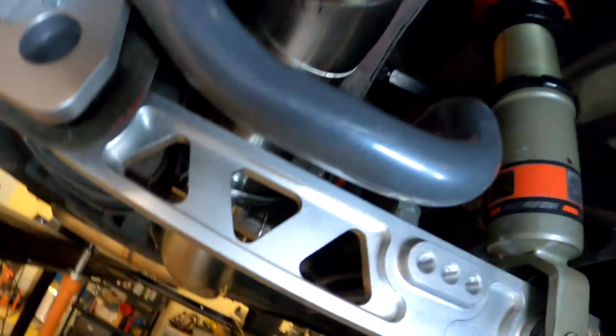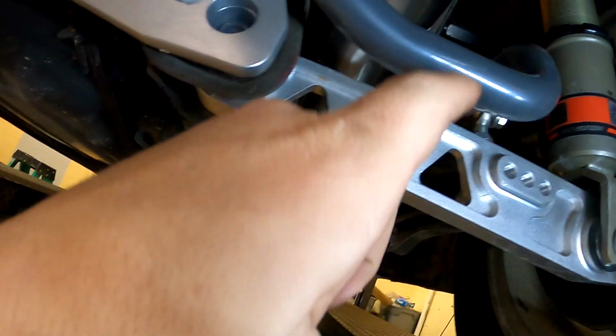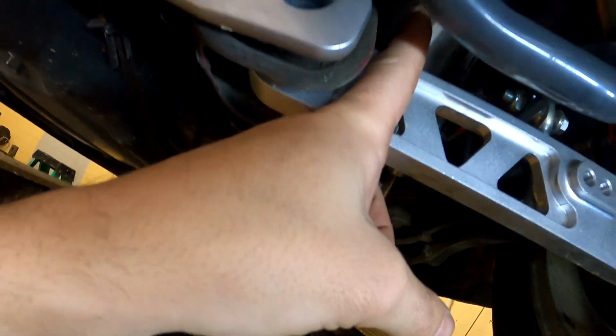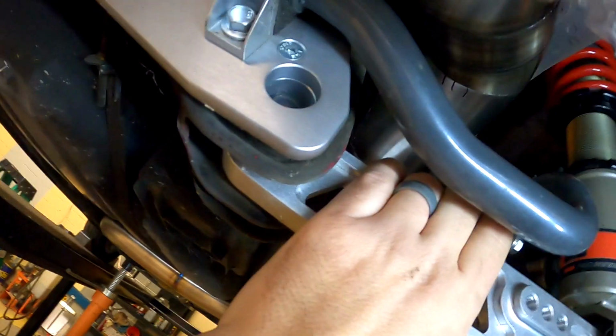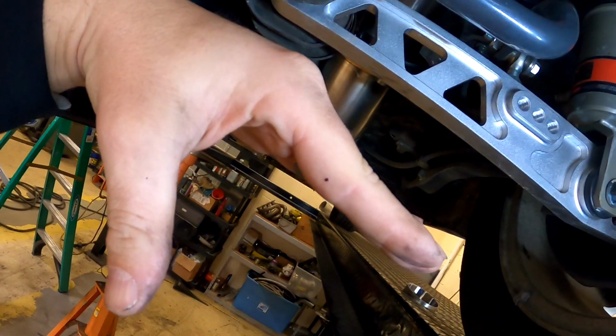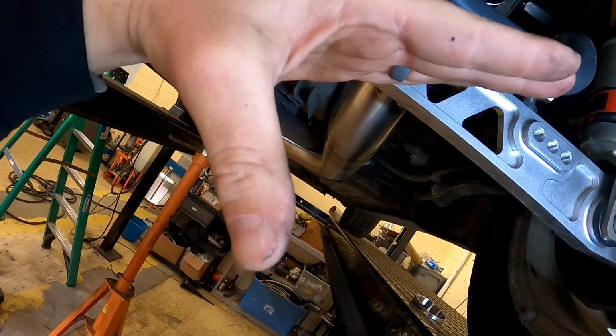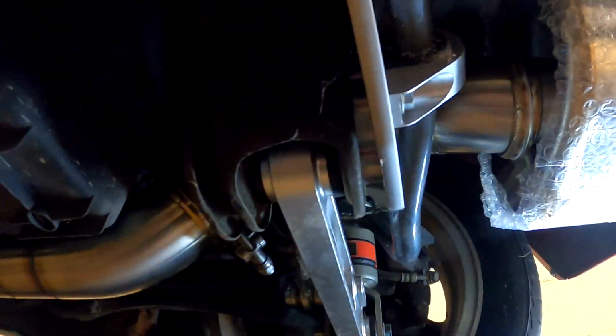Another thing to keep into consideration when you're going over a control arm like this is here's the pivot point. So the closer you are to here, the less this is gonna go up and down, whereas the further you go this way, the more the suspension is gonna travel. So pretty close over here. The car is on a four-post lift, so this is what we have for available clearance, whereas if you do this on a two-post lift, you can learn the hard way that the suspension will sag. You think you clear it, and then you lower it down on the ground, and then you smash right into it. So I'm gonna, I guess, weld all this stuff now.